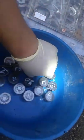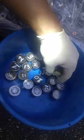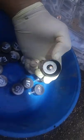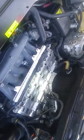It's a five-cylinder 2.5 liter, and pretty much the rear two cylinders, four and five, weren't getting any oil. Number one on the exhaust side looks nice and good. Going halfway down the line, number 15 is getting a little darker; number 18 is even darker; number 19 is getting burnt; and number 20 is solid black. The leading cause for all of this was a faulty oil pickup tube, which we're going to be replacing. So if you guys have one of these Volvos, make sure you change that oil pickup tube before it fails.